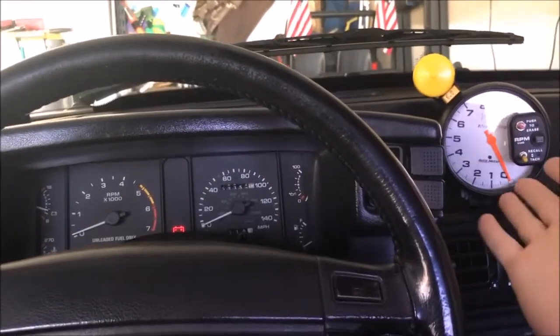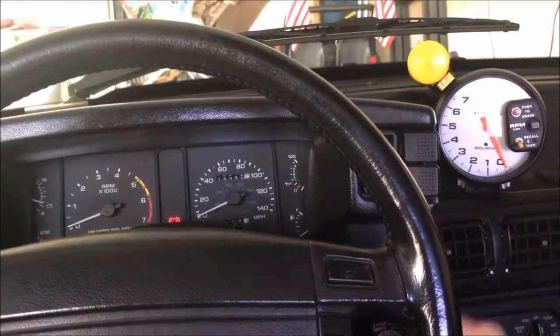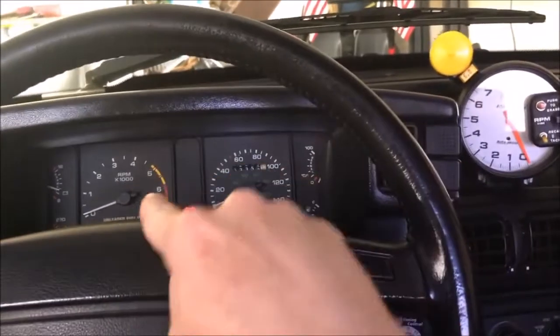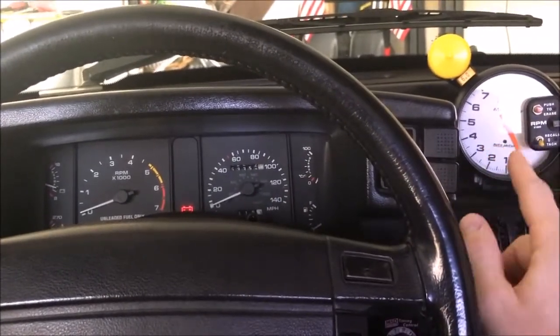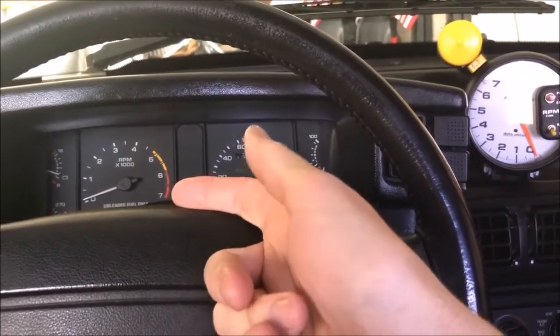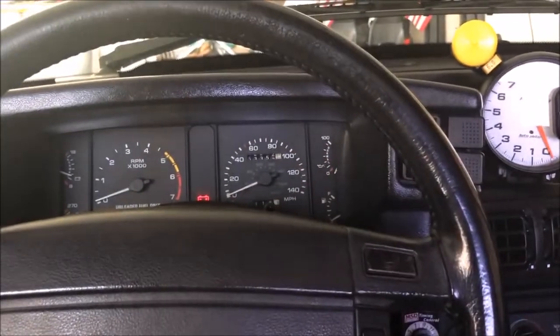Just quickly before we get started, I want to comment on the ricer-inspired Monster tach. Cut me a little bit of a break — I got this car in high school, and what loser doesn't have a Monster tach? But moreover, this tach is severely off; you'll see it wrap all the way down to about 7,000 RPM before this one reaches six. There's actually a functional reason for it. The engine doesn't break up at all around 7,000, and I've got the 6,000 pill in the MSD box, so it should start breaking up around six.